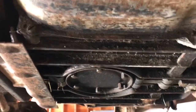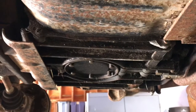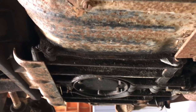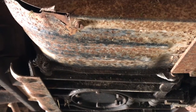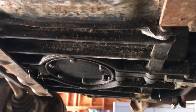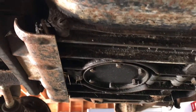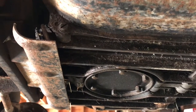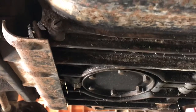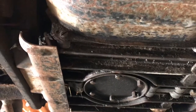You can get oil filter kits that either plumb in through the oil cooler lines if you remote the oil cooler, and they also make one that hangs off of a special oil pump. I'd probably not do either of those things on this. We'll just stick with the tried and true strainer method and just frequent oil changes. Won't be driving it that much anyway, summer car.